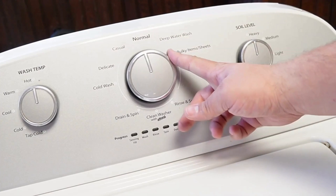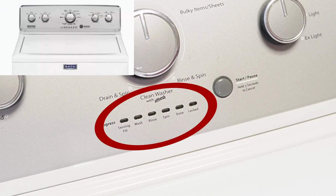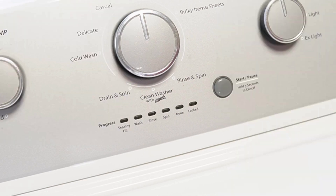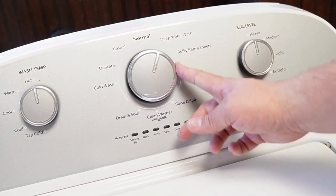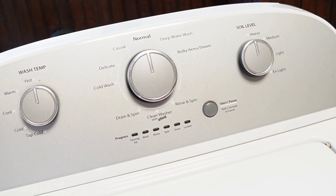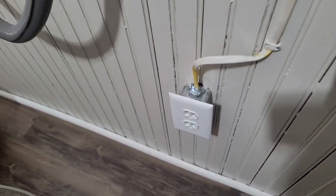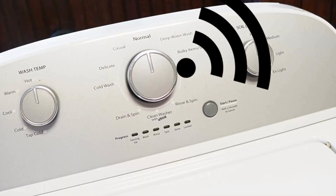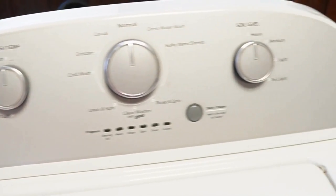Note that these steps will work for all washing machines that have these oval LED segments just below the washer dial, and that includes Whirlpool, Maytag, Kenmore, Roper, Amana, Admiral, and Crossley brand washers. For the first reset: rotate your washer's control dial counterclockwise until it's at the north or 12 o'clock position. Then unplug the washing machine from the wall and wait about a minute before you plug the power cord back in. You should hear a faint clicking noise from the back of the washer relay as it boots up. This first reset should restore your washing machine to all default modes and settings.